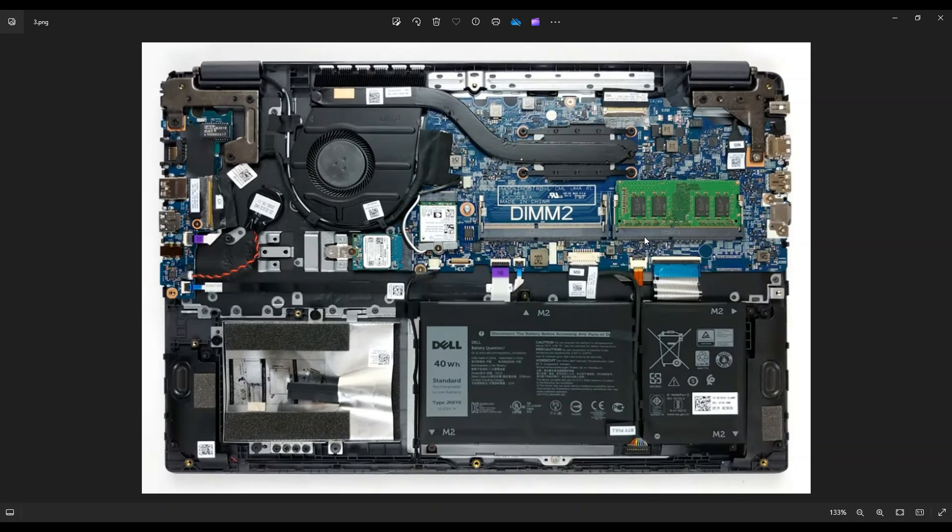To operate the RAM, there's a spring-loaded metal arm on either side. To get a RAM stick out, pry those arms apart from each other, away from the RAM stick gently. The RAM stick will then release — it'll often pop up a little and you can slide it out of the port. To put it back in, there's a long section and a short section to the port so you can't put the RAM in upside down. Once it's in nice and flush with the gold line even, press down in the center and the metal arms will latch on and hold it in place. Below in the description I'll have a single 16 gigabyte stick for replacements, and a couple of 32 gigabyte kit options — two 16 gigabyte sticks each — for those who want to max it out.